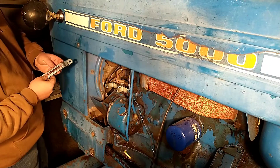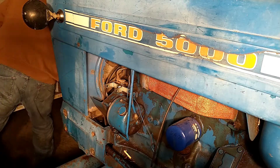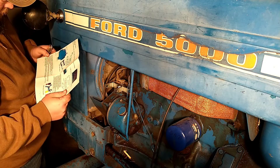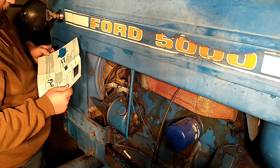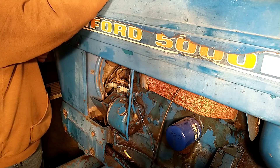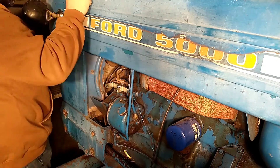I don't know if this connects the same place the old one did. The instructions mention using a hole in the head. The original one went off one of the water pump bolts. The instructions say gas models mount above on the head boss while diesel will mount on the radiator gooseneck bracket. So I'm going to stick the alternator in here to see where that bracket needs to go, but first I'm going to tighten up that water pump bolt.